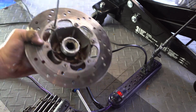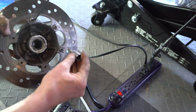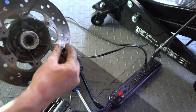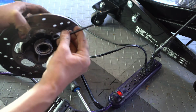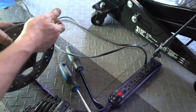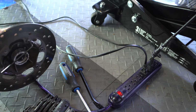Okay, so we got to take this off and put it on the new one, but one of the things we noticed is this is kind of not good enough, and you're going to want to strip it. So we found that using a good Allen wrench like this, right size is number 4, gets these bolts off rather well, and there's Loctite on them, just so you know.